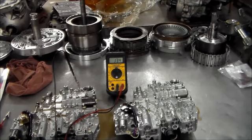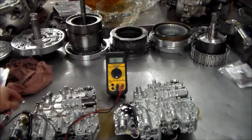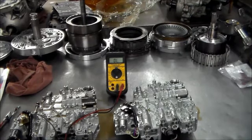If you had the transmission out for other repairs — like to the differential — and you didn't change the valve body, you should be able to drive it and it should adapt itself. But if you're changing the valve body, they say it has to be relearned through a scan tool. I'm going to get set up back by the car to install the new valve body, and I'll give you a shot underneath with the valve body out of the trans.